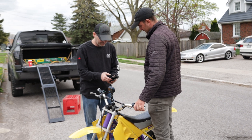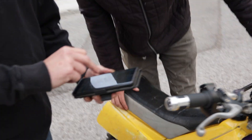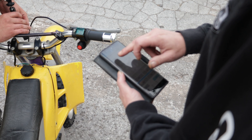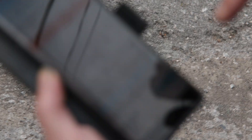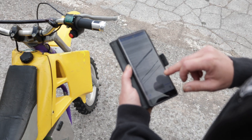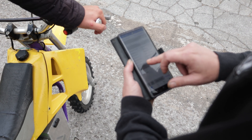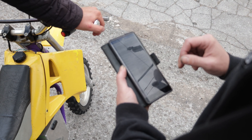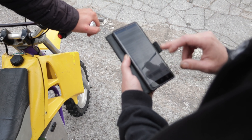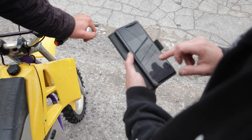What I want to do is change the throttle line for the little guy. Go into the app: communication, scan, connect, go to parameters. Throttle step is set really high right now, and it's not even on sport mode — you should see what sport mode does, it'll wheelie like there's no tomorrow. We'll put it on eco for the little guy and turn the throttle step down a bit. We'll try 160 — it's at 224 right now.